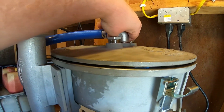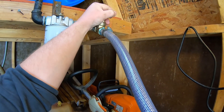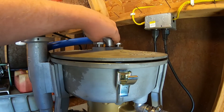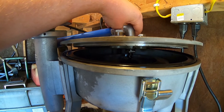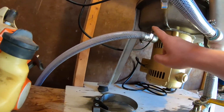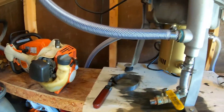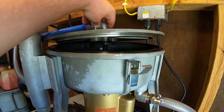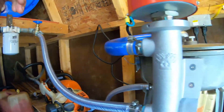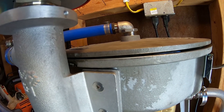Yeah, that's too quick, so we're going to shut that off and close this on down. Last time I ran this it was a lot colder out, so I had to run these valves open quite a bit. I'll let most of that drain off — all the sludge and everything comes out of this hose here and empties into this five-gallon bucket down here. Now that we've slowed it down and this valve is closed, we'll open this back up and all we want is a nice stream.